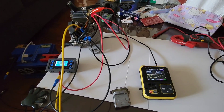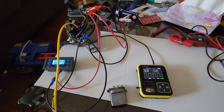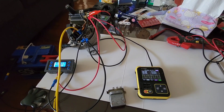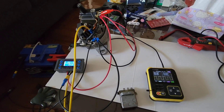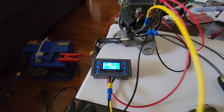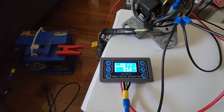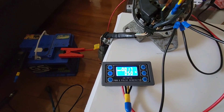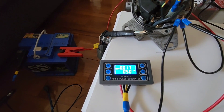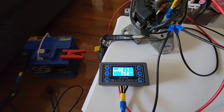This is a video about testing your igniter. I've created a test rig made up of a signal generator, currently set to 17 Hertz with a 50% duty cycle. This is to emulate what the ECU will be sending to the igniter.